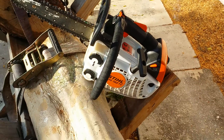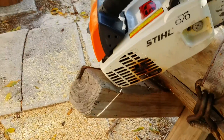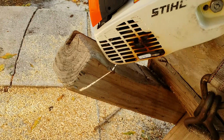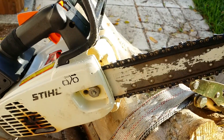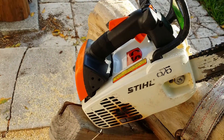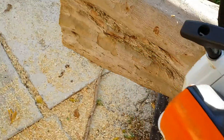I do the exhaust port with the piston intact. I just take the muffler off and get in there with the CC Dremel and port it, stone it, sand it, and polish it. Then I do a bunch of work to the muffler, and I think it picks it up quite a bit. All the guys I've done — at least 40 of them — and all the guys I do them for are real happy with them. They bring me all their little 192s to do.